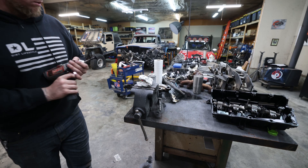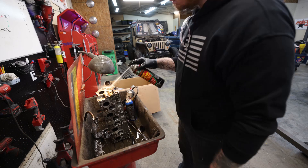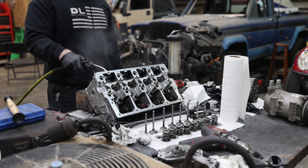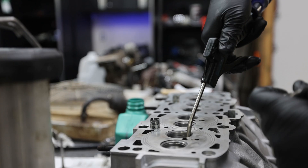In the interest of making speedy progress, I suspended shop class for a bit and just got some work done. I checked all the valves — they looked great. I cleaned all the carbon off every valve and then went through and cleaned this head very thoroughly in my parts washer. After that it's time for the real check: lapping all these valves. Now that everything has passed all my checks up to this point, I know it's worth the time to lap them — both to check if they're bent and to make sure this head has a really good seat to allow the cylinder to build proper compression.